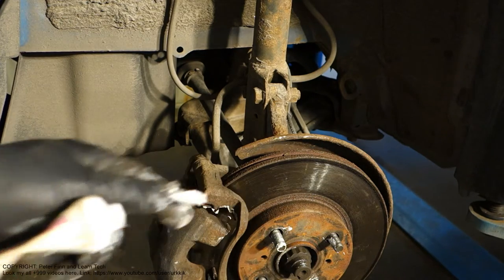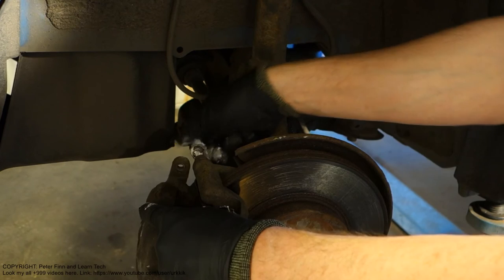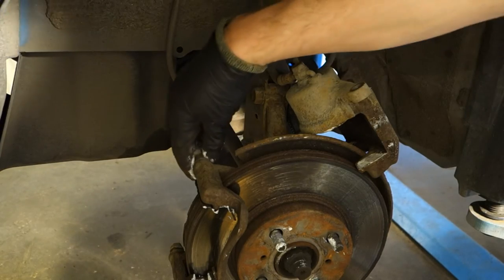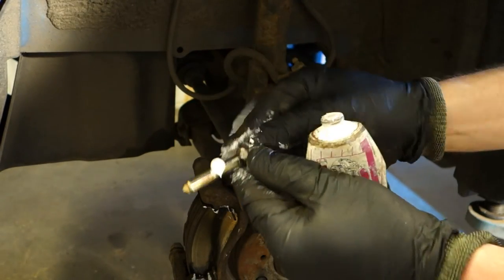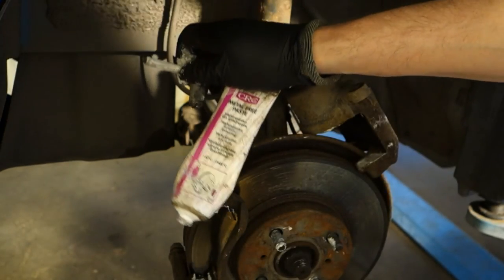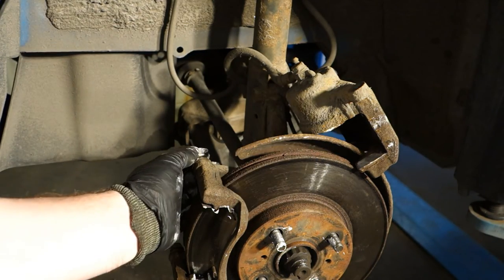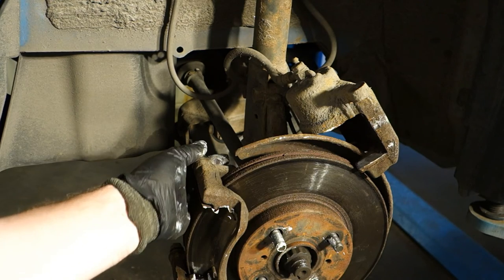I insert this grease in here, and then these bolts are really easy to install back in here, and there is no corrosion. And the final step: if we have those movable joint bolts, like in that car, that are in here, we can lubricate these also, because all moving parts need lubrication. Now I used only one brake lubricant, but there are even very specific, slightly better greases for some of these points, like the rubber area and these areas. But this metal-free paste is better than nothing.